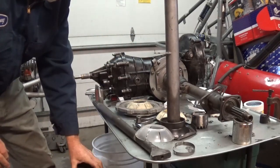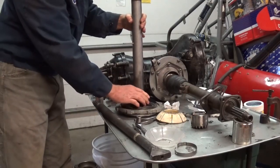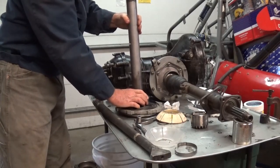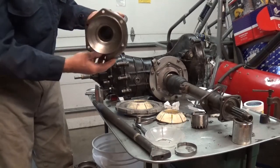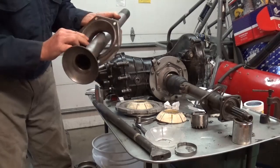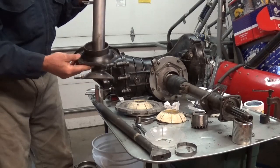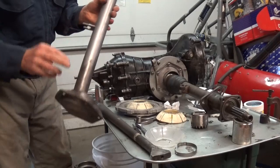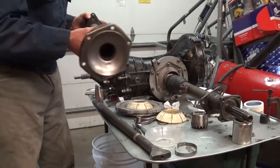I'll take this one off and put this one, which appeared to be good — the one I fought with for a long period of time — and I've got play up and down. The reason is this is slightly deformed around here because this was out on a sand rail one time, it overextended and bent this. If I had a die or a way to beat this thing back into position I would, but I didn't, so I had to go through a lot of work.